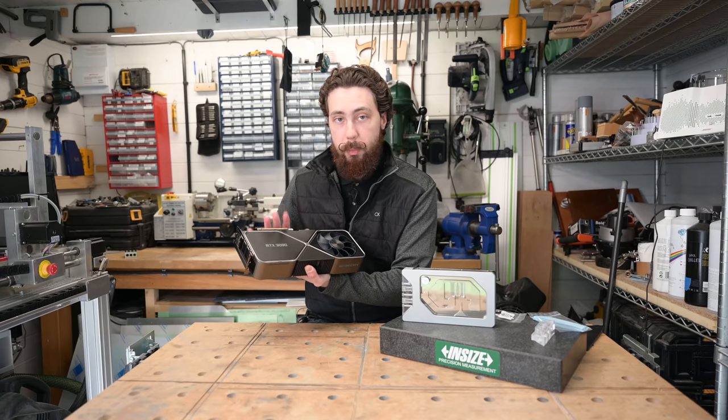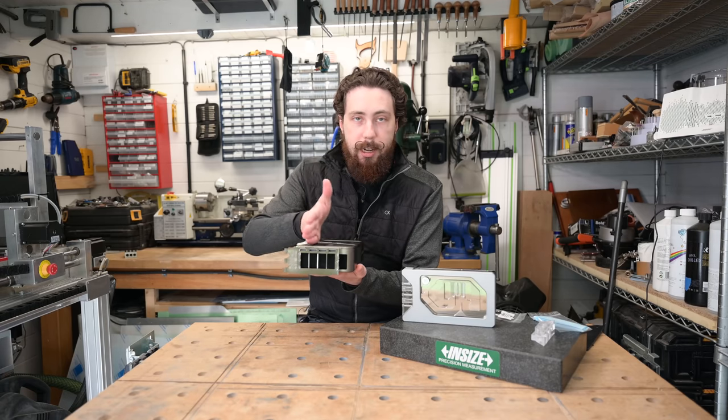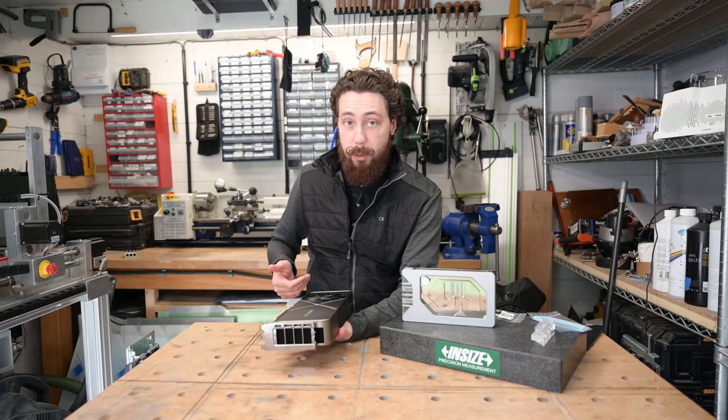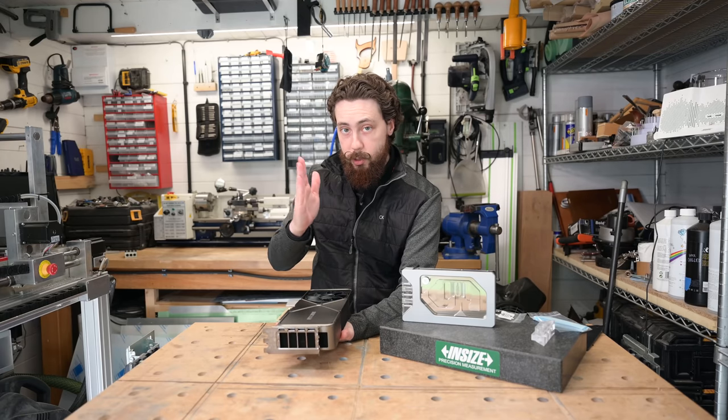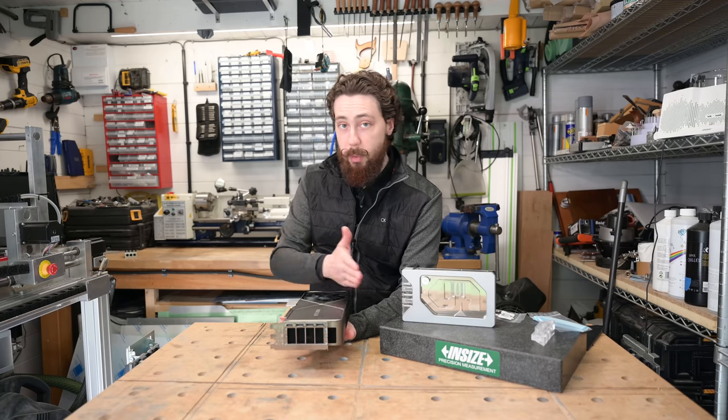You know exactly where it will be on the motherboard. The problem is that the height of the card can change. And that means if you're designing a distro plate, when you've got to put ports in certain locations, you've kind of got to take into account how far your terminal is going to be sitting from the motherboard.